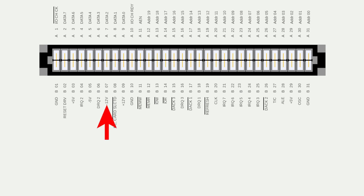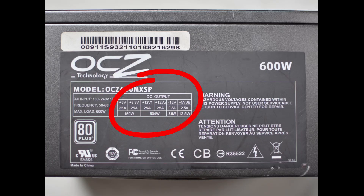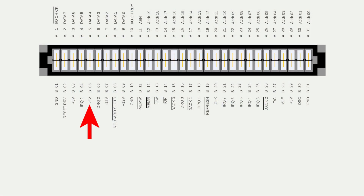The ISA slot, starting with the XT, is specified to deliver minus 12 volts on pin B7 and minus 5 volts on pin B5. All the pins of the ISA slots are connected in parallel, so usually there is no difference between them. That's why pins B7 and B5 are also connected with each other across all slots. The voltage to these pins comes usually directly from the power supply. But what if you want to use a modern ATX power supply which doesn't deliver minus 5 volts? All the B5 pins in the ISA slots would be just floating, and some expansion cards which need that voltage wouldn't work.